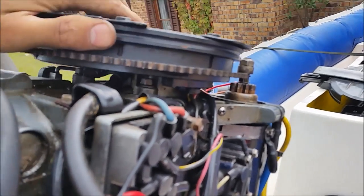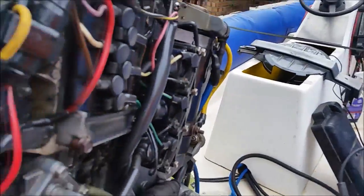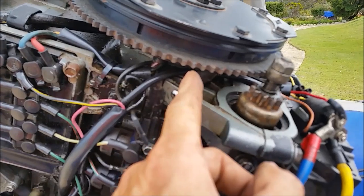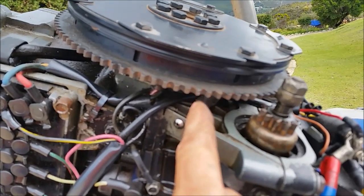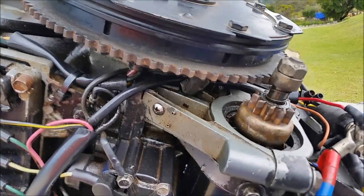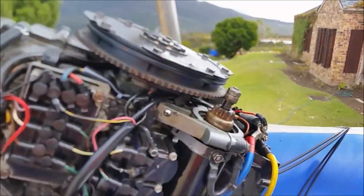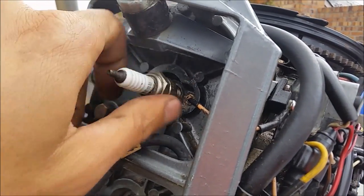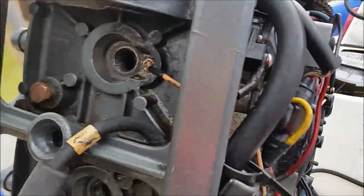Mine has just stopped right over there, so my piston is just lightly contacting the end of the spark plug. I had a little piece of garden tie that I tied around here and put it just on the tip of the flywheel over there. That was actually my first mark — you can see it's a little bit lighter over there. So you put a little wire here that's not going to move when you turn the flywheel, and you make a mark — let's call that mark A. Now what you do is go back to your machine, unscrew this, and FYI this does replace the dial gauge method as per the manual, at least for the time being.